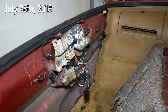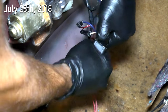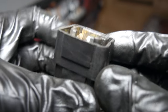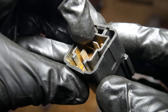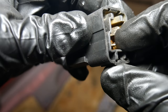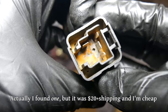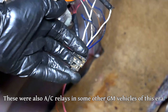The first step we'll take is taking another look at that relay - if we can get the crusty thing back off of that connector. Looking at these terminals, I had started to do an initial cleaning when I noticed a terminal in the corner that is not looking so good. It's become so badly corroded that it's barely even connected - just kind of hanging on. So this relay is toast and we're going to need a new one.